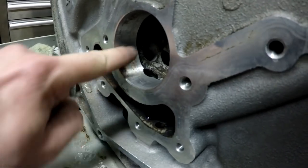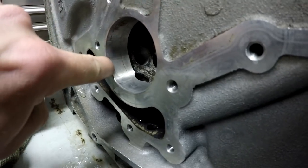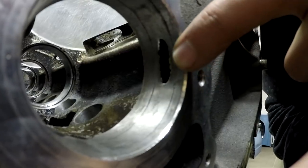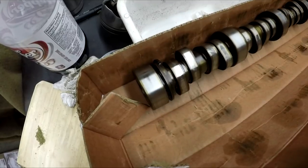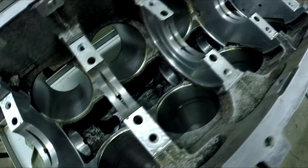This is the first thing you're going to want to do once you have your engine down to bare block form. This is just the bare cam journal — you can see here, this is where the bearing goes. You can kind of see the lines where the old one would sit. If you look from this angle, you can see the little hole inside there — that's where the oil comes in and goes in between the bearing and the cam. So the idea is that the surfaces of the cam ride inside those bearings in the center of the engine, the oil gets through, and everything's happy.